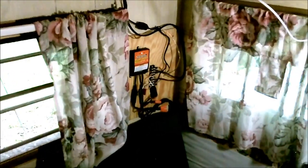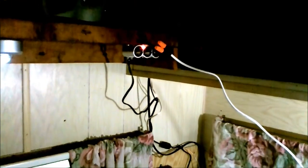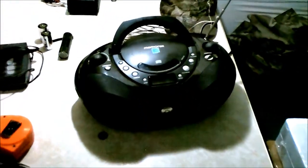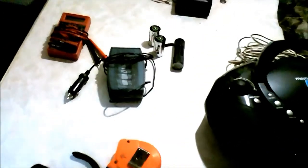On the load side, I have it hooked into a fuse, going into a bus bar of sorts, and that feeds the camper wiring, which I've mostly redone for the 12-volt style plugs. I have a few other things like lights and a fan hooked up to it. With this system I can plug pretty much anything that uses 12 volts into it, like a radio or CD player.